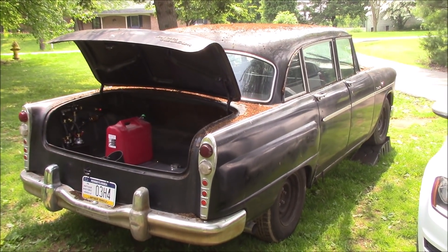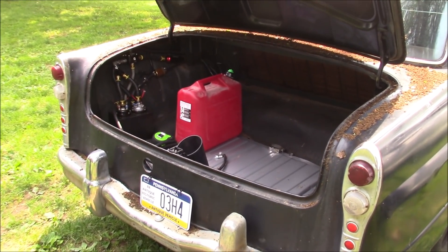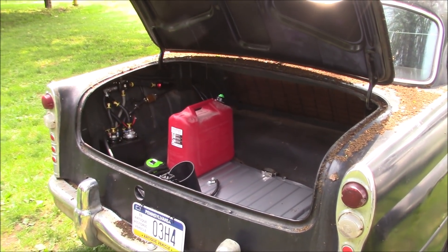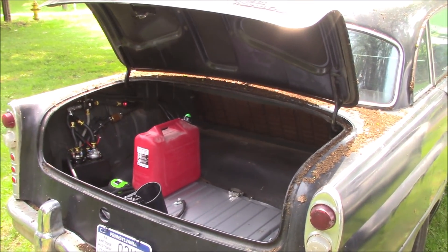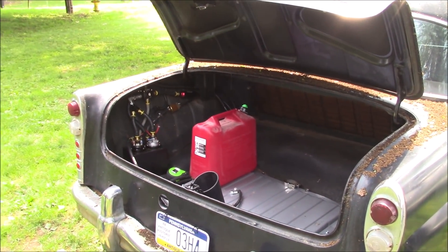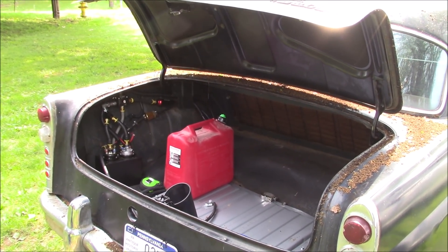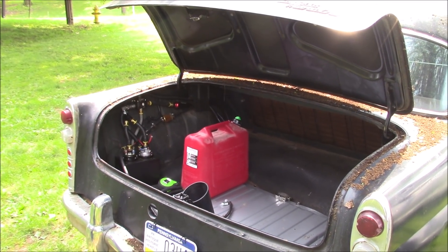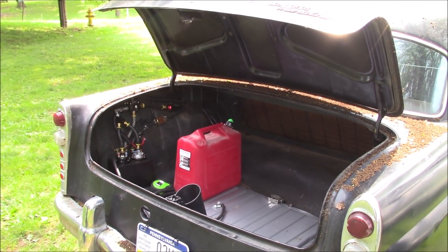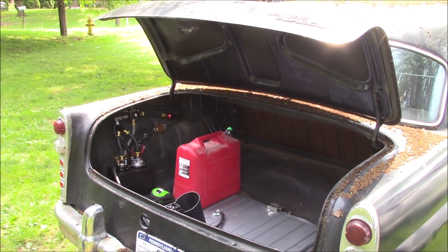Time to resume the exciting adventure of the Checker. In my absence, Cory drove it and it clogged the fuel filter instantly - much worse than the motor home, like two or three minutes. It was terrible. The problem was the lift pump was getting backed up immediately; it couldn't push through the dirt once it wouldn't go through the clear carbureted filter to feed the surge.